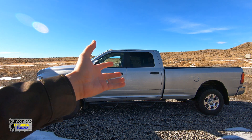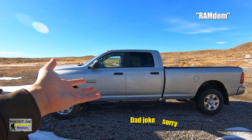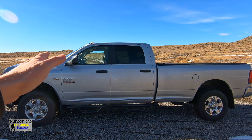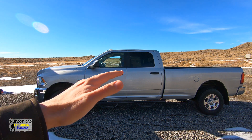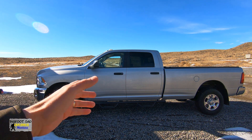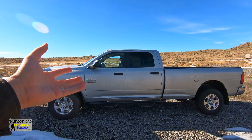This RAM has a problem. A very RAM-den problem. It leaks — it leaks power and no one seems to know why. Does it do it when I take it to the dealer for a week and a half? Nope. Does it do it when it's time to go to an important appointment? Yep. Not completely dead — the interior lights, power locks, radio, and instrument cluster still work, but there's just not enough voltage to feed the starter.